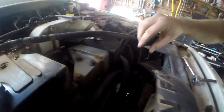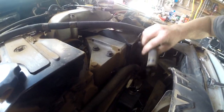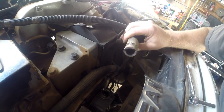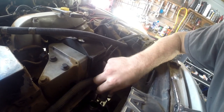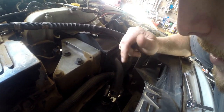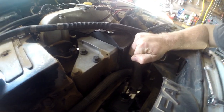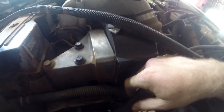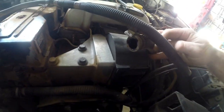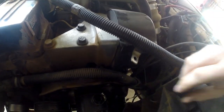And if you're unfamiliar with the 24 valve, they have a little catch can right there. That's the breather crankcase vent thing. After a while, it's filled up and it was leaking over. I mean, after 100-something thousand miles sitting, and cleaning or nothing. So this one just vents to the ground like it would do on a 12 valve. So get that one out of the way.